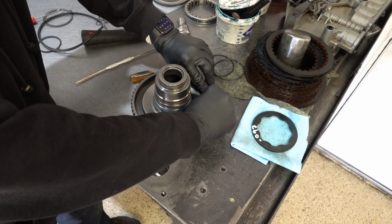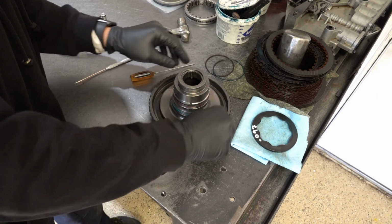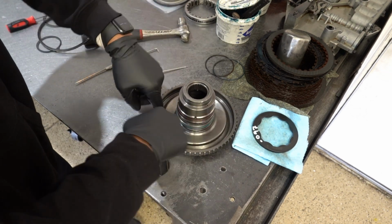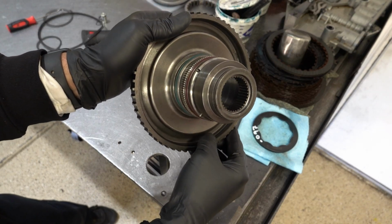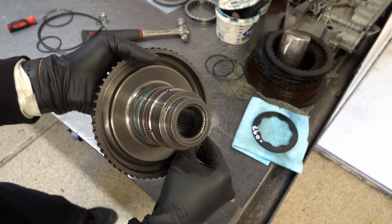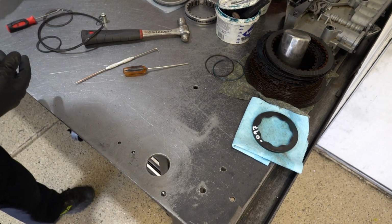That last little bit can be tough because the rest of it has to spread out across the entirety of the groove, but it'll go in. The main thing is you don't want to force it. And just double check. Make sure there are no problems or issues. Make sure it's fully installed in that groove. A good way to do that is to take your thumb and pull upward on the lip itself, on the very edge, and seat it one final time. All right.